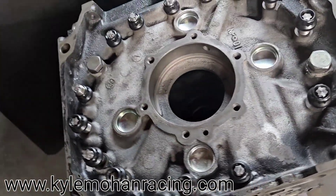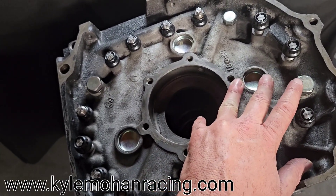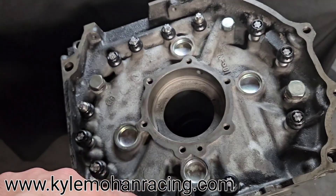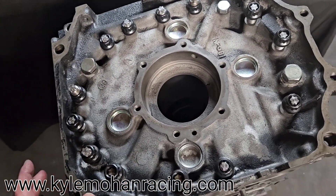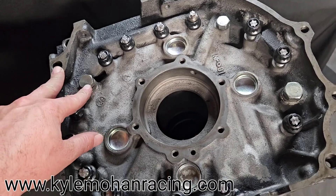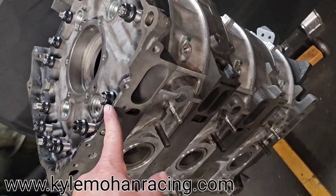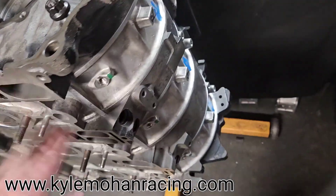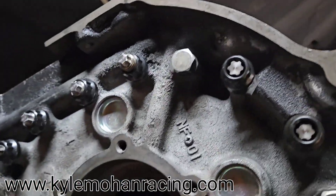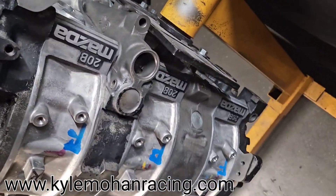It's kind of a combination. Generally I would not leave these factory oversized tension bolts, but in this case we did. Normally what you'd be looking at is 100% studs. But still at this point being about 95% studded, this is a very strong block. In a lot of cases, because we're working with older components, sometimes we do have to work around what's already been done with motors. This motor has a street port. It is for a sand rail — an off-road race motor — and this one will definitely be achieving over 1000 horsepower. So we had to get involved and basically add some strength and reliability to this block.